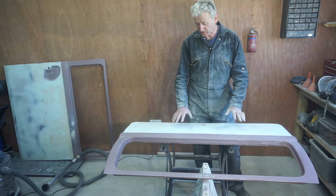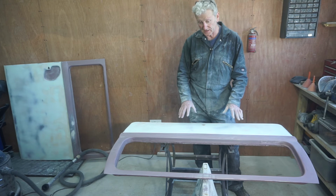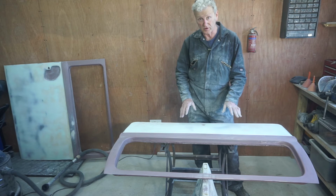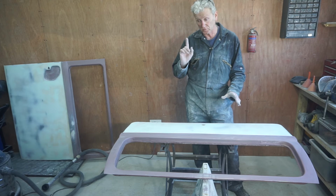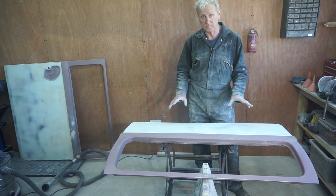Gone over both doors with 240 grit to give them a final rub down. Next step now is to give them a coat of high build primer. Before I do that though, I want to sort the front bumper out and the two new side panel caps, so that I can spray them all at the same time.